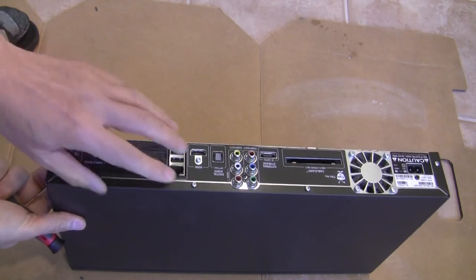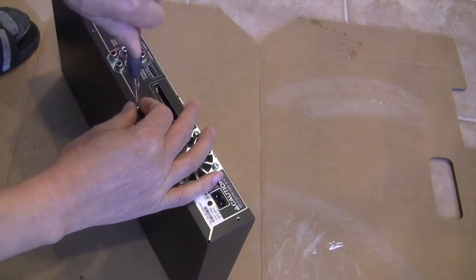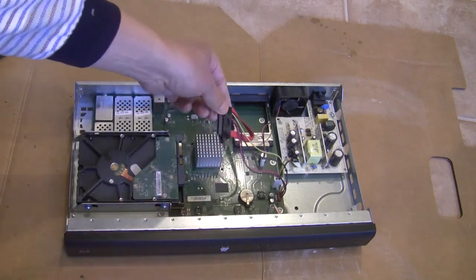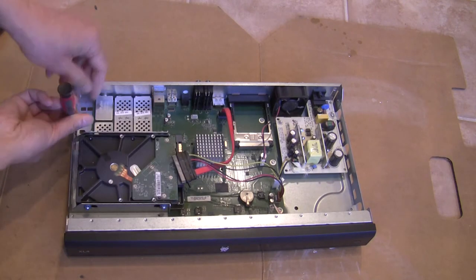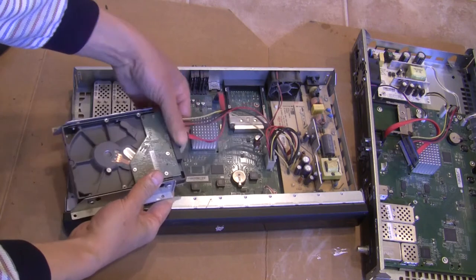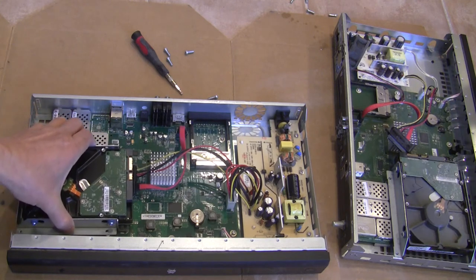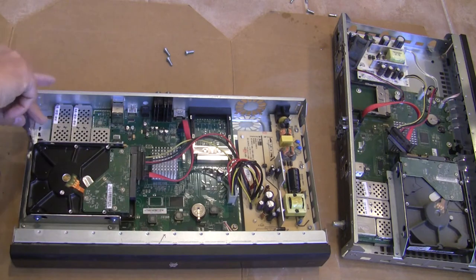The lifetime subscription stays with the circuit board; we only swap the hard drive and the fan here. You can also swap the power supply if you want. Remove the screws holding the top cover on and push to remove the top cover. Push the cable connector away from the hard drive and remove the screws holding the drive to the bottom, then lift the hard drive out. Repeat the same process and take out the hard drive from the other box. Now reverse the process and install the good hard drive. While at it, replace the fan too — just four screws holding the fan and one two-pin connector for the power source.